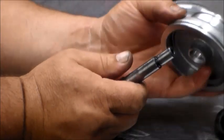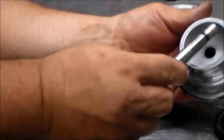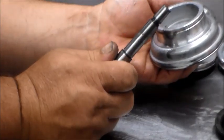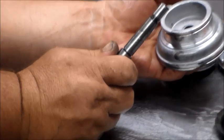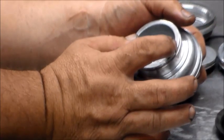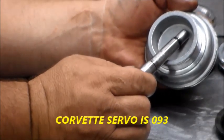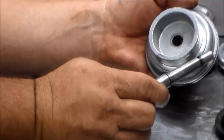This one's in pretty decent shape. This does fit a pickup - it's basically a 553 designation, it fits most trucks, Tahoes, SUVs. They've used the same thing in almost everything. The Corvette is actually a smaller diameter - I believe the designation is 962. When I say designation, that's the last three numbers of the part number and it's stamped on every one, easy to find.